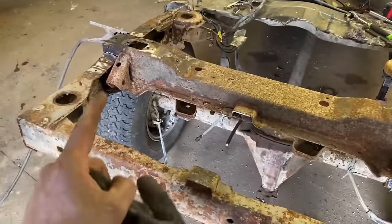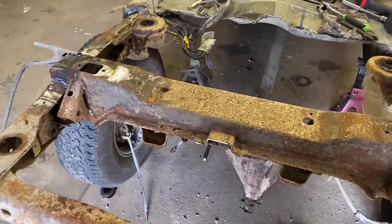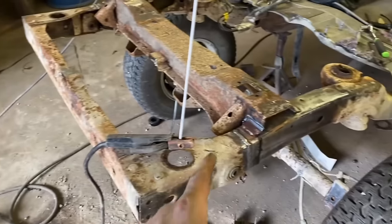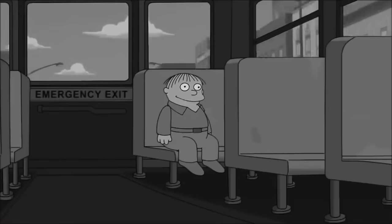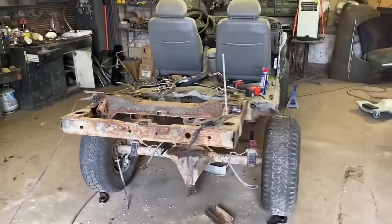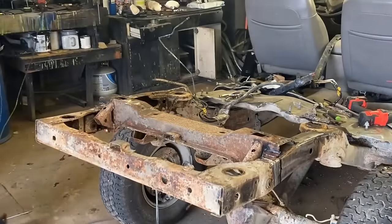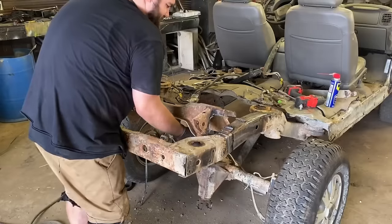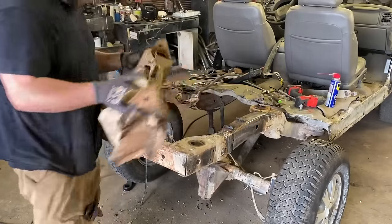This thing's being real stubborn and I can't get my plasma cutter up in certain angles. I think I clogged the tip of the plasma cutter with the undercoating - so now it's in time out. We're going old school - stick welder turned up way too high. It will melt through about anything. I've cut lots of frames this way whenever I didn't have a lot of good tools. Let's make some sparks - there we go, damn that's heavy.